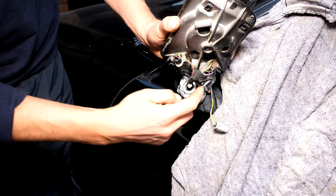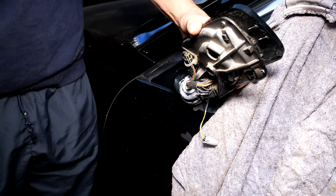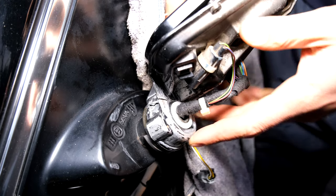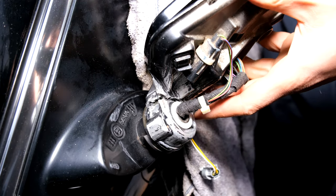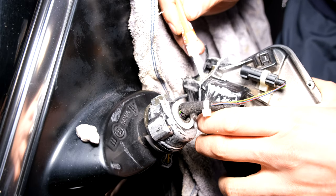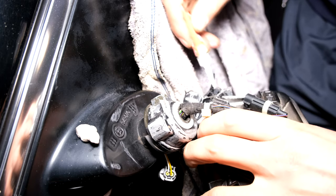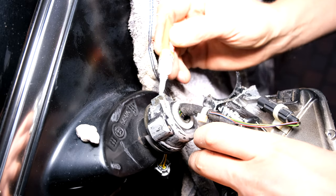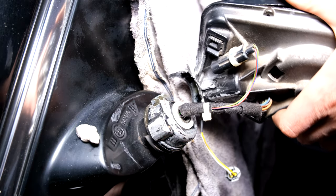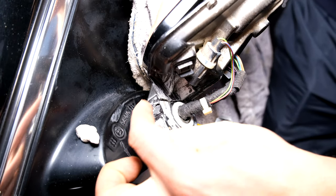So all I need to do is do a preliminary stick. I'm going to put superglue all around the cracks and then it will stay in place, then I will start with the epoxy. If I flip this up, that's where I'm going to glue along this line and to the other side. The sticky putty does come in handy and I will use it shortly. So the first step is to put superglue all over the section that has the tear — these are the mating surfaces. Now I can seat this and it's very important to make sure it's flush.